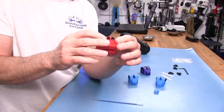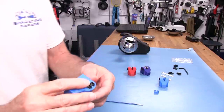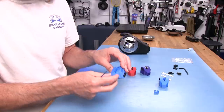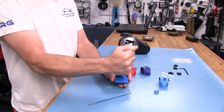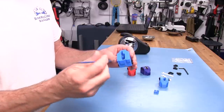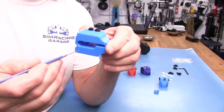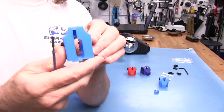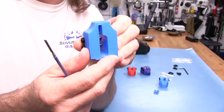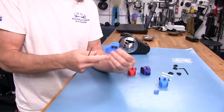But those guides only last a certain amount of time — they're going to wear. You can see on the one I used that one side is actually a little bit lower, worn a little more than the other. That probably has to do with the arm angle on the shifter because you're always pulling on one side more than the other. As they start to wear, the original tension on your shifter — how hard it was to push back and forth — is going to change. Before we couldn't do anything about it because the Pro has glue on it and they don't want you adjusting the tension.